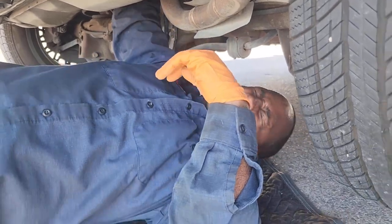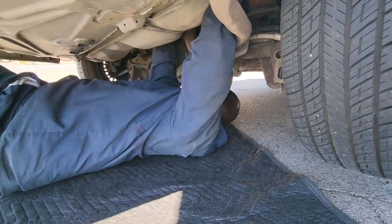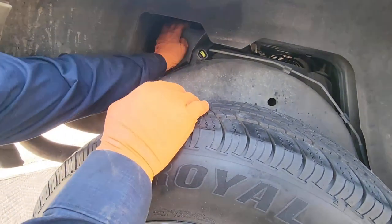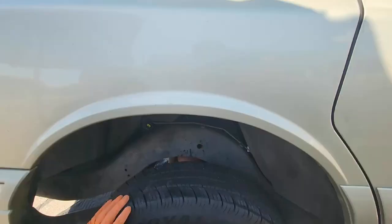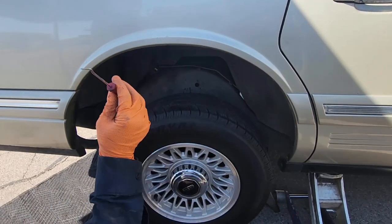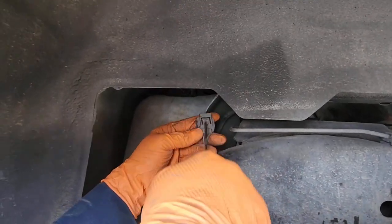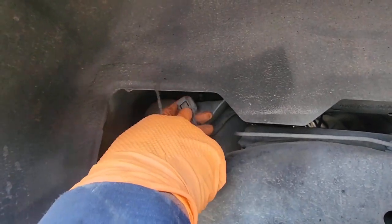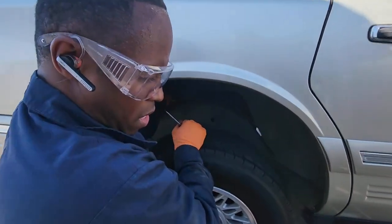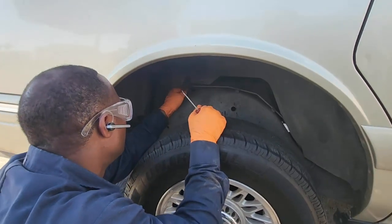I need to put my safety glasses on — I didn't know it had so much rust under here. So what I did is there was a connection right up here, and I used my handy dandy ice pick to get on top of this and push it down. A lot of videos show that you need to cut a hole out — you don't. Just use this to push it down, pull it out really slowly, and take off these fuel pump bolts — I think they're 8 millimeter or 10 millimeter.